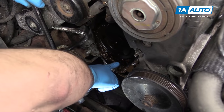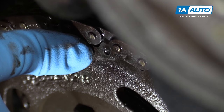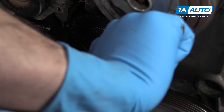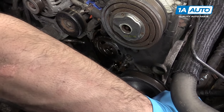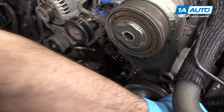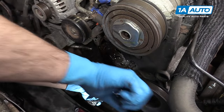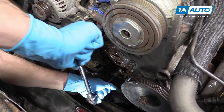Here we can see both timing marks. There's a dot on the crankshaft and a dot at the 12 o'clock position on the camshaft. The reason both are at roughly the 12 o'clock position right now is because your crankshaft rotates twice for every one rotation of the camshaft, meaning that while the crank is at top dead center, the cam is not positioning the intake valves for a compression stroke — it is actually 180 degrees out on its exhaust stroke. So we're going to bring that around, and this time when our dot comes up to the top, the dot on the camshaft will be at the bottom and they will line up with each other.